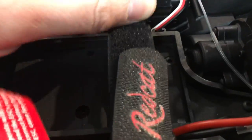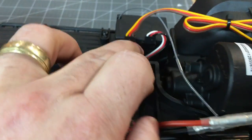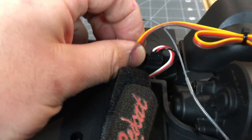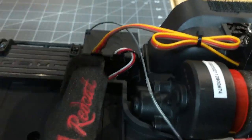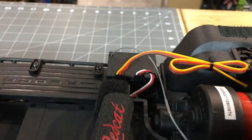This is really cool too - you can disconnect the servo and ESC without taking the waterproof receiver box apart. Now, this area is also a good place for water, dust, dirt, and debris to get in. What you can do is put a little dielectric grease in there, or fill them up, or apply some brush-on electrical tape or silicone glue - that'll help insulate it.